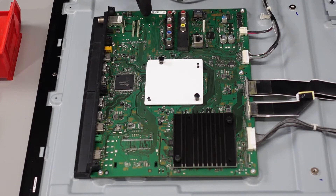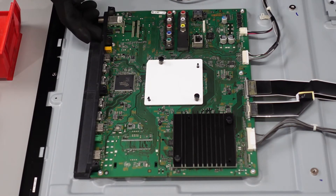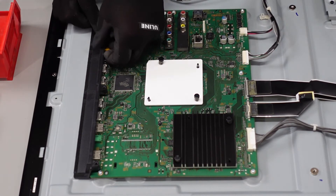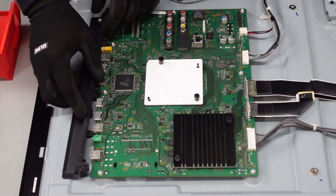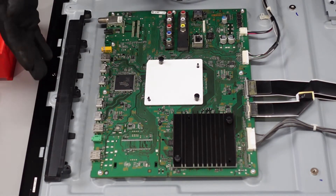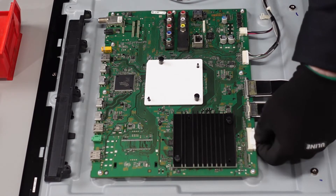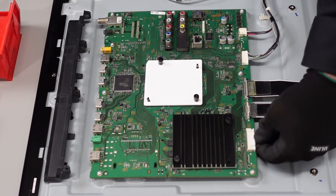First up is the main board. We have a couple different styles of clips and attachments on this side that we need to get away, as well as a plastic piece we need to free up from the main board to get to the screws underneath it. It takes just a little bit of force — if it's getting stuck, don't force it; you don't want to break anything or cause any fractures. For these clips, the first one we're going to depress with our thumbnail to release the clasp.